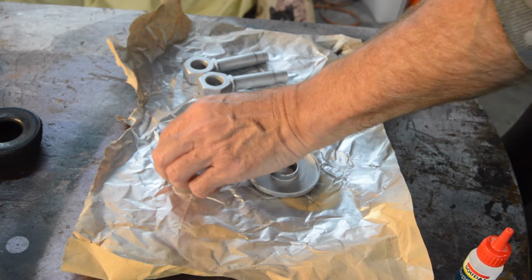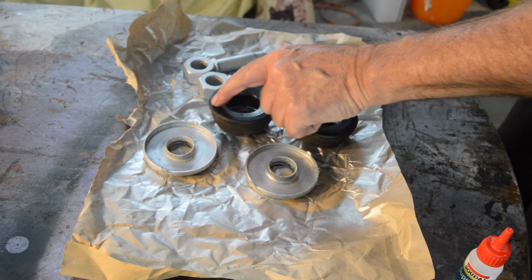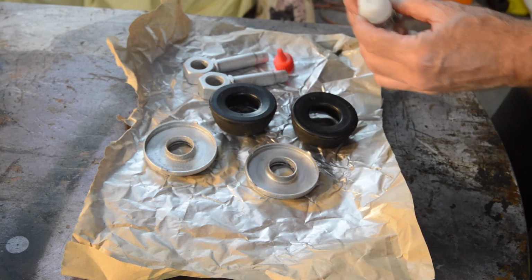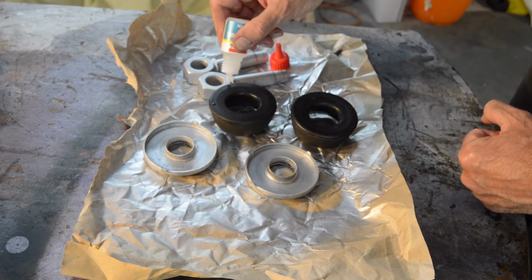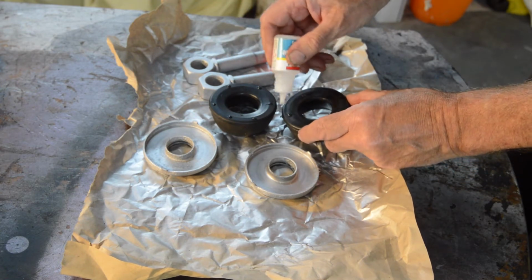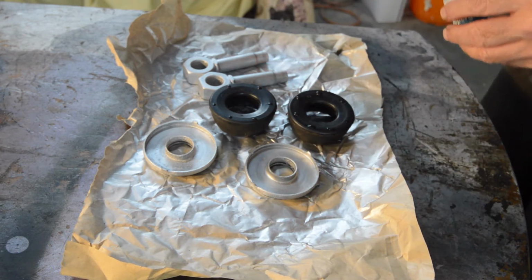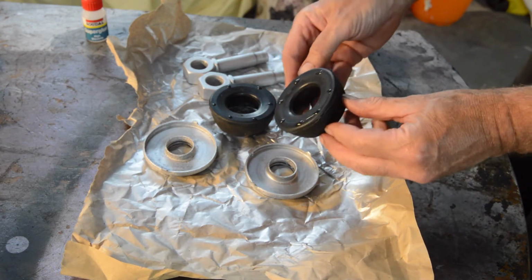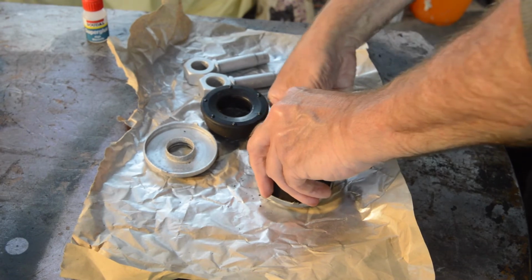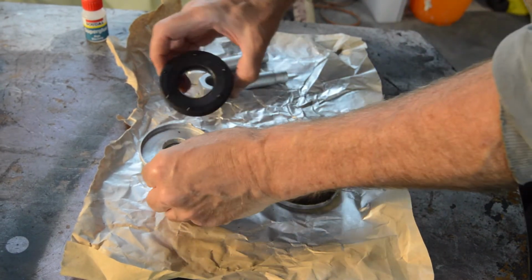And then we have our rubber bungs. So cleaned off the rubber, and there is a raised section around there, and we're going to use some French super glue, because super glue is pretty good at bonding this sort of rubber. I've used it before. Just a few little dots. It's Soudal's extra strong, extra thick, which I prefer in the workshop to ordinary super glue. It just seems easier to control. And then we're going to stick them back in there, like so, shedding bits of rubber on the way. Make sure they're all the way in, which they are.